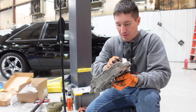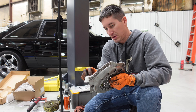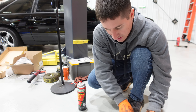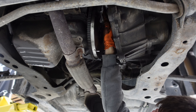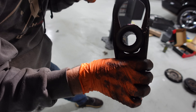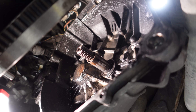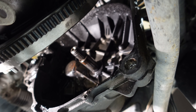Quick coating of brake clean for the pressure plate — do the same thing to the flywheel too. Make sure there's no shipping oil on here; I know they don't want it to rust. So we're going to go ahead and pop the entire arm off of here for the throwout bearing. It just slides in and snaps in there. I'm going to put this in the parts washer and clean it up — everything else in there looks pretty reasonable. There's no play in anything; she feels solid.